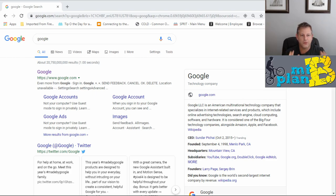We're going to go to RockShox's website, go to the service area, and find the service manuals for performing the 50-hour service — as well as what's included — to make sure I am capable of actually doing that service and that there's no special tool I need to fabricate before I start. Also, my shock tunnel has a bit of damage inside, so I want to inspect that damage to see how bad it is. If it's not too bad, I'll put some helicopter tape inside the shock tunnel to further protect it.